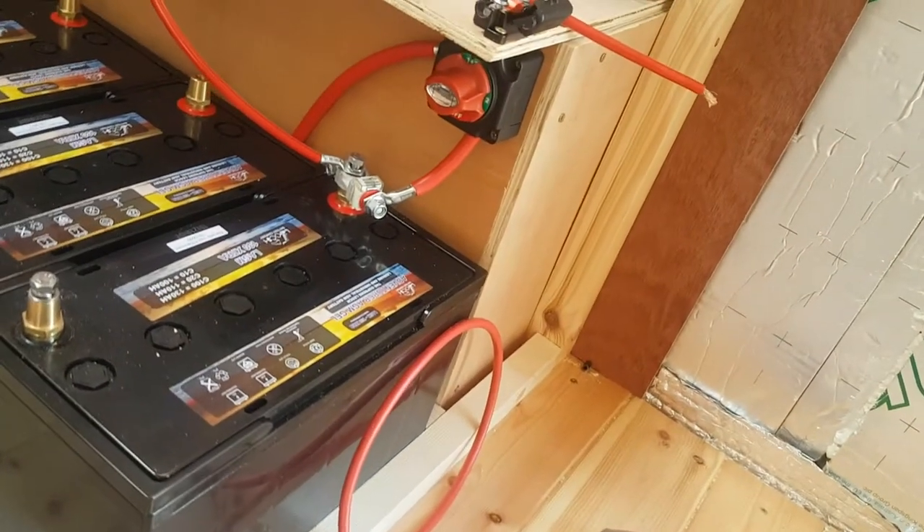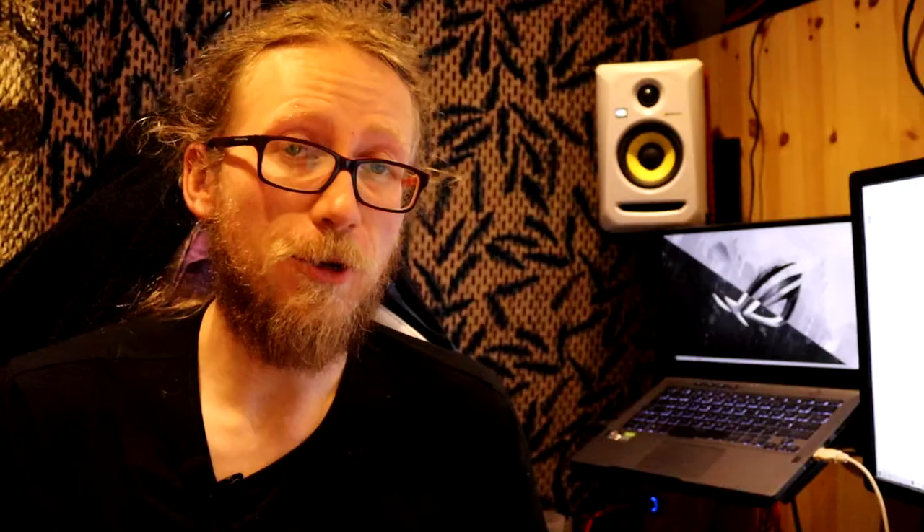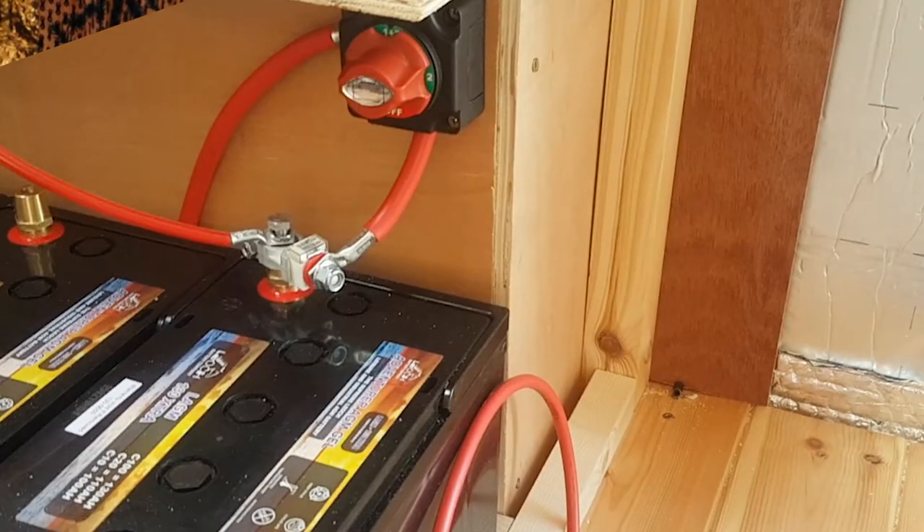At the front I put a big battery isolation switch which enables me to turn off all of the draws, although not the charging — I don't have a switch for that. The idea was to cut a hole in the bed front piece — Arrested Development reference, if you know you know. I like being able to turn it off at night; it prevents ghost draws and turns off all the blue LED sockets I've got everywhere and the heater screen, which is really bright and draws quite a lot of power. I put that switch as close to the positive terminal as possible to minimise that cable.